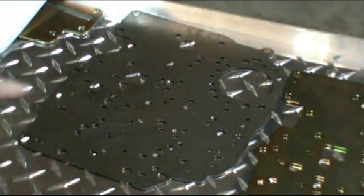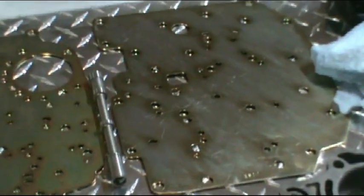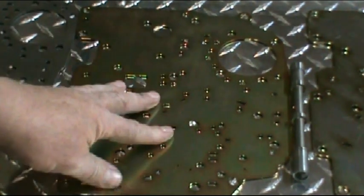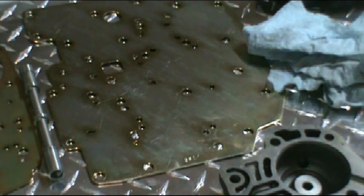There are also differences in the separator plates. The first separator plate is a stock 350 Turbo automatic. The middle plate is a B&M shift kit separator plate. Then there's the manual valve body separator plate — as you can see there are not very many holes in that one and it doesn't use any check balls at all. The stock and B&M plates, depending on application, use check balls — in the street strip application you only use two check balls.